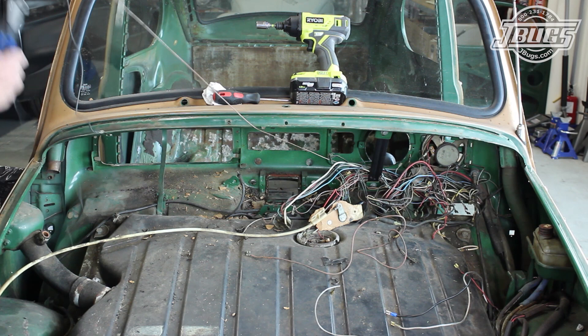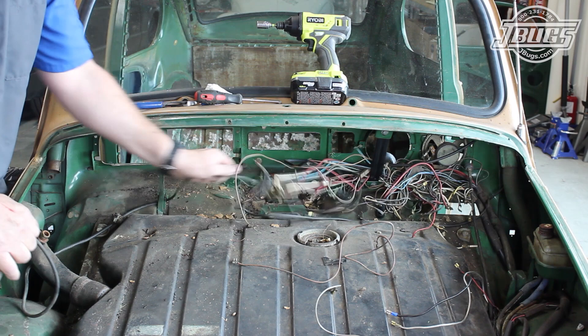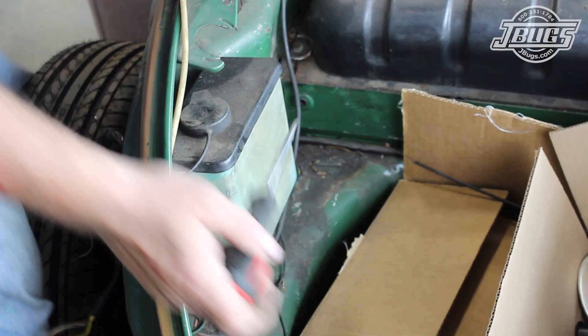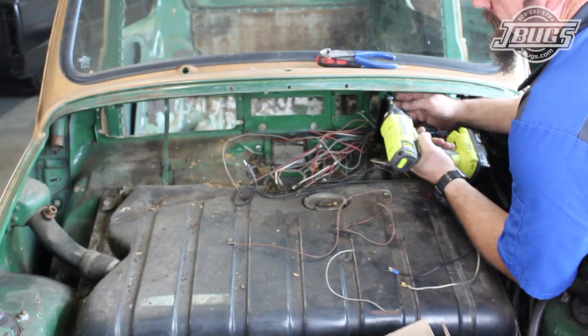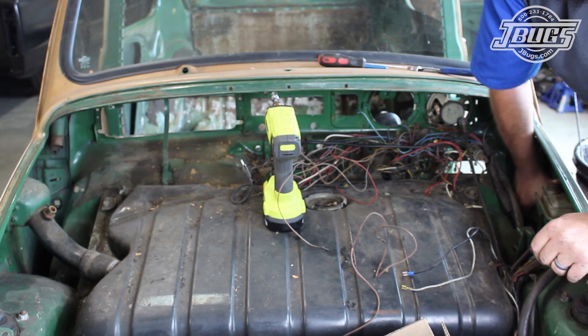The wiring for the aftermarket washer bottle is cut away as is the remaining portion of the filler vent hose. The clamps for the fuel filler hose are removed. The washer bottle hose is removed along with the aftermarket washer bottle. The hood release cable is tucked out of the way. Then the dash brace is removed from the back side of the dash. The left side quarter panel vent hoses are removed and again we save the vent tee.